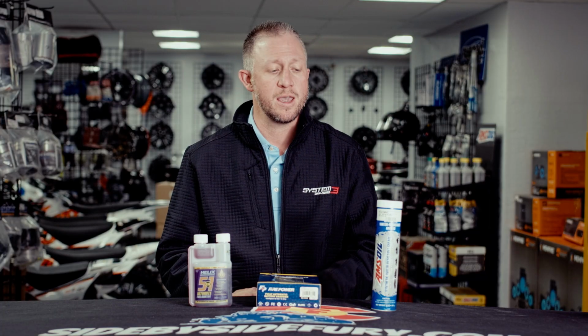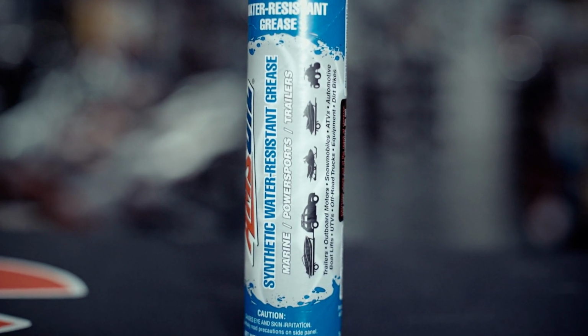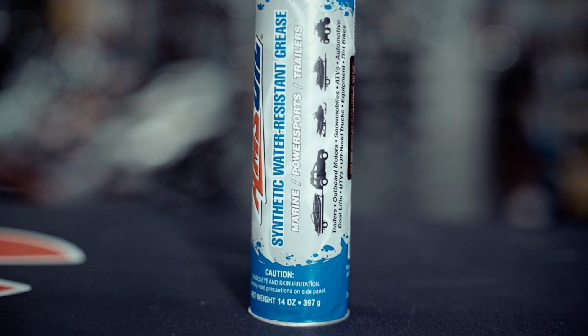And then if you're a sled guy and you want to bring it out and go through it, make sure everything's nice and greased, make sure your track tension's there, the ice scrapers are in good condition, your carbides, things of that nature. So seasonal prep is very important.